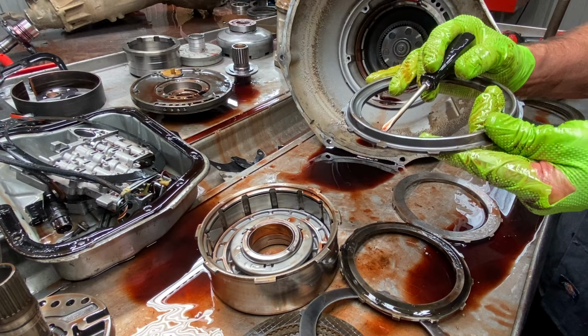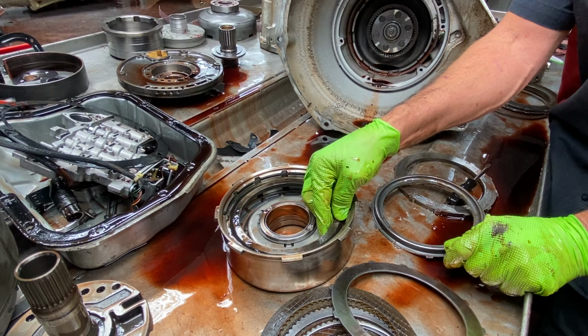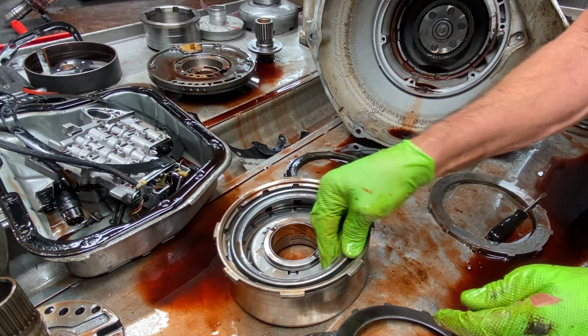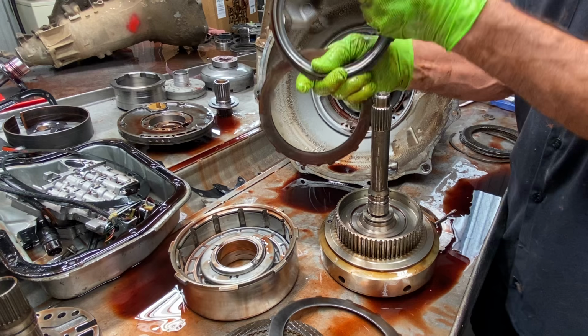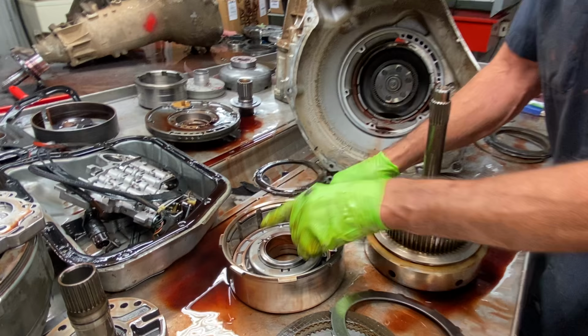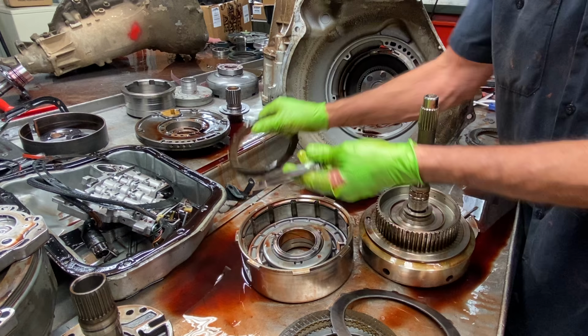So now, this right here is the third gear drum plate that gives you five clutches when you have a low snap ring drum. See, you can do it with this too, but the problem you got, this is sticking up so high that it's going to rub right here. Where this has been machined down, it won't rub, see? But this will, that's why we come in and cut this off right here. But we cannot use this one or this one in a high groove drum and add seven clutches. If we do, no matter how you do it, it's going to rub right here. You can only do that in a low groove drum. Okay? I hope y'all got that, because that's really important.